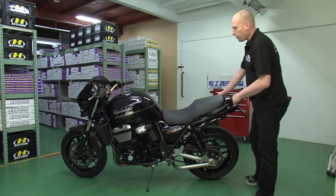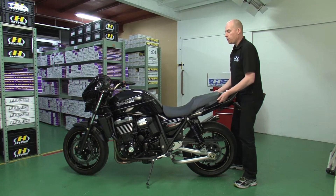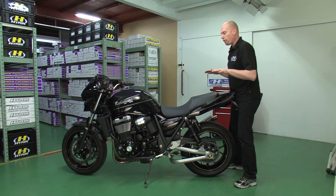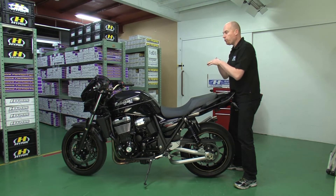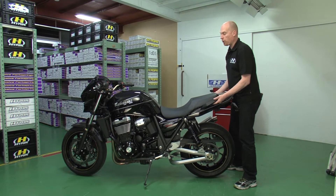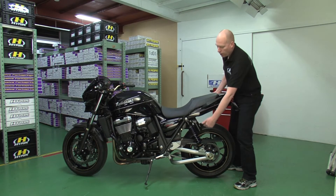After that I want to measure the static sag of the rear. I check if I can lift the bike up — in a normal situation the bike must be able to move up. If I can only push it down and it goes back up to the top, it means it cannot follow a dip in the road. To follow a hole in the road I need to have some static sag, so first I check whether I have any sag at all.